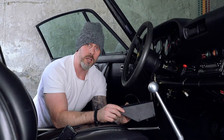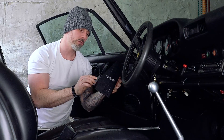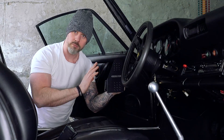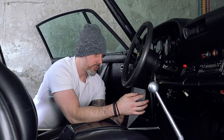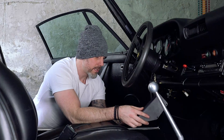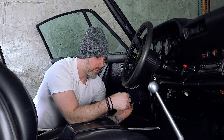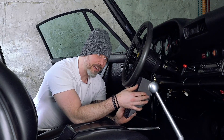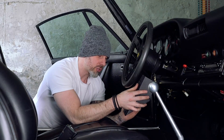Okay, so the holes are now marked for the mounting holes for the dead pedal. Now, Rennline instruct me to mount it using four points — the two at the front are totally fine, but the ones on the side require getting around the pedals to drill. I'm going to take a bit of a gamble and only mount it using the first two bolts. I think when they're secure, the downward force will be enough; you're not constantly going to be pushing the pedal against the side of the wheel arch anyway. So I'll try it with these two and see how secure that is.